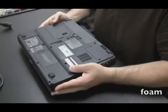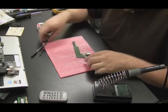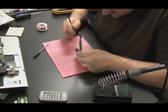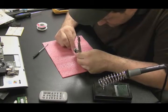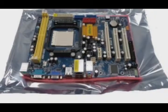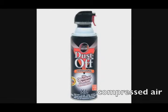I always use a piece of foam when I'm working on laptops so I don't scratch the top of the laptop when working on it upside down. You can also use it with circuit boards if you don't want a delicate circuit board touching the work surface. I usually get these foam pieces out of desktop motherboard boxes — when you get a motherboard it's typically shipped with a square piece of foam under it, and that's pretty much exactly what I'm using.